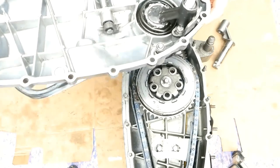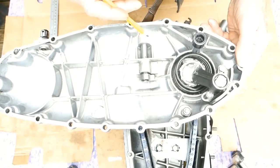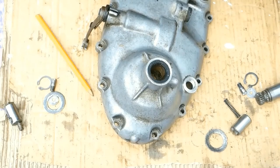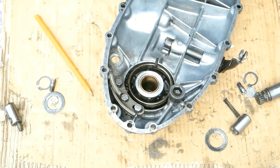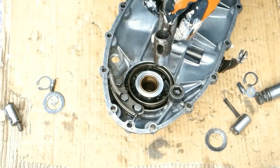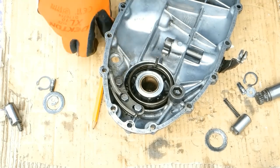It did provide the clue. As I look at this, the issue was staring me in the face — I just couldn't see it at the time. When I put the new shaft into PJ, I could get a flat 1mm shim plus the circlip on. When I put it into A-bar, I could get 3mm of shimming on plus the circlip. And then I twigged. If you look at ads for the later model shafts, there's usually a rider stating that they can be used on early models with a modification to the crankcase. The only description I can find of the modification required is a company's tool you can buy to carry it out — a shaft that fits in here with two small grinding stones sticking out at right angles, then tapering to a shank you fit in a drill. It seems you insert it in there and let it burrow until you've ground 2mm off this area.